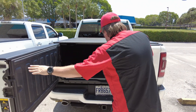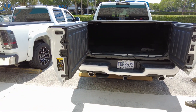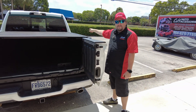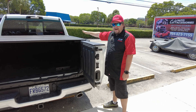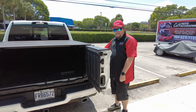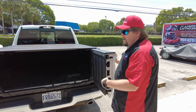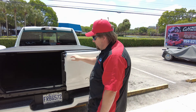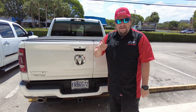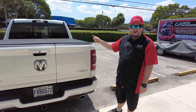If you have your tailgate open — that you paid a lot of money to upgrade to — in the barn door configuration, those brackets are there because it adds weight. What's going to happen is when that shady shop takes those brackets out, puts the cover on, and sends you down the road, you're happy at first. But over time you can bend the side of the bed. Also, one day you load it up at Lowe's and it might not want to latch. Your biggest issue is going to be when you do this — it's going to hit and not close. That's the shady shop doing the work wrong.